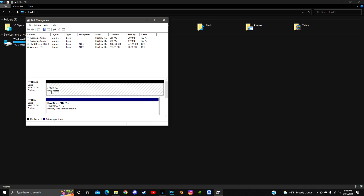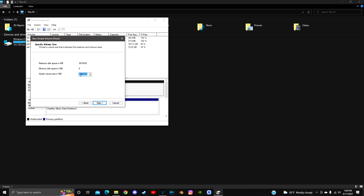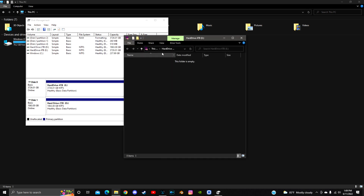All you want to do is right-click where it says unallocated, click New Simple Volume, and it'll start setting up that hard drive. Keep the settings the same as shown at the top and click Next. It'll say assign the following drive letter — I'm going to do E because I already have D, and most of the time you want to go in alphabetical order. Click Next, and then it'll say File System — make sure this is NTFS. In the Volume Label, this is what your hard drive is going to be named, so I'm going to name mine Hard Drive Four Terabyte. Click Next and Finish, and it's going to say formatting.